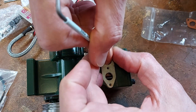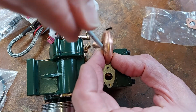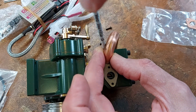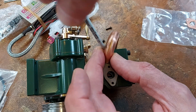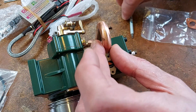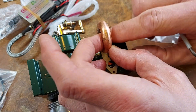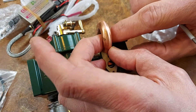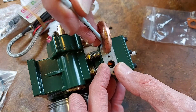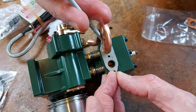Allen keys are fabulous because they've got that ball joint at the end, and it's on jobs like this that they come into their own. You can just about get a purchase onto those bolts. I'm going to lift the exhaust out of the way while I get an initial start on them. Then just tighten that one down a bit with my fingers, and then with the ball joint — fabulous they are for that.